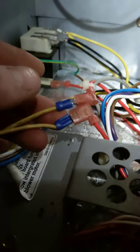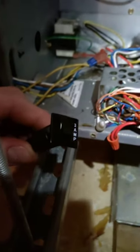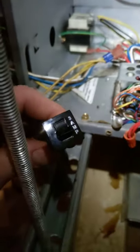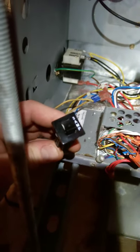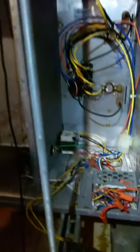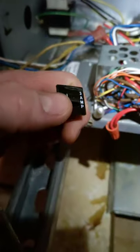That's where our old fuse went, so I plugged in a little resettable 3-amp breaker right here. That way if there is a dead short it'll trip, but it's the best thing to have. If y'all don't have one of these in your toolbox for low voltage troubleshooting, you need to — you can go to Amazon for like eight to ten dollars and get a 3-amp and a 5-amp resettable low voltage breaker. It's perfect for troubleshooting low voltage shorts so you're not wasting a bunch of fuses. All you do is simply reset the breaker when it trips until you can narrow it down, find that needle in the haystack, and locate that low voltage short.